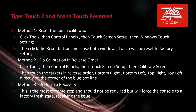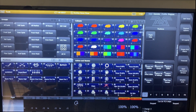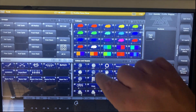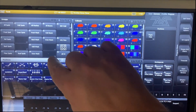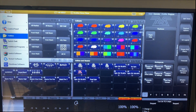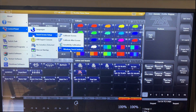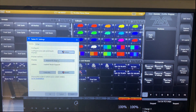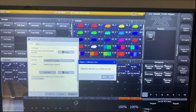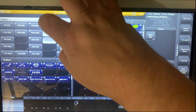Here I've got an Arena on version 13 of Titan with the touch not currently working correctly, as we can see. So if I go ahead and click my mouse and click Tools, Control Panel, Touchscreen Setup, Windows Touch Settings, and then click the Reset button, and then hit OK and close that out, we see the touch now works again as expected.